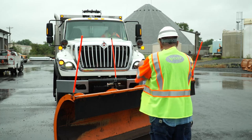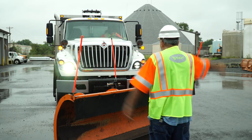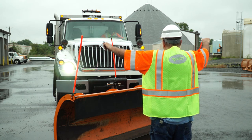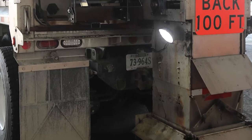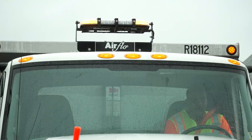When inspecting lights, stand back and view them from where other motorists would see them. All headlights and turn signals must be visible with the plow up or down. Some vehicles have two sets of headlights — only one set of lights can be illuminated at a time. Check that the spreader does not obscure the tail lights or rear turn signals. If the equipment has a rear spreader light, it must be pointed downward. Spreader lights must not shine into the eyes of following motorists. The vehicle must have a flashing amber auxiliary light that is visible from 360 degrees as viewed from another vehicle. The light must be amber only — white lights or amber-white combination lights are illegal.